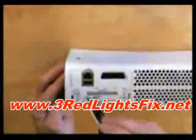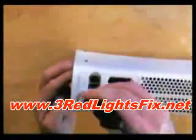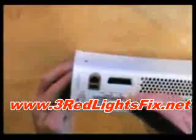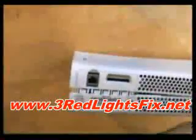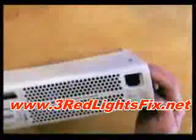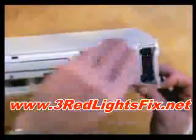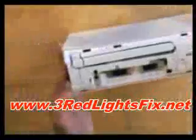What I'm doing is pushing this apart like that and at the same time pushing in on the clips — you'll hear the clips click. And that's the back off. On the front you're just going to pull off like this. There goes your Microsoft warranty.